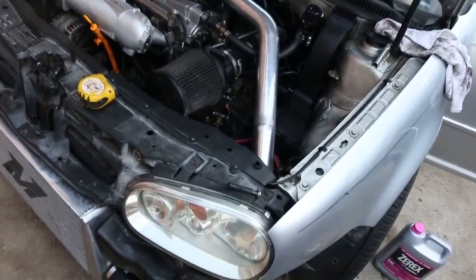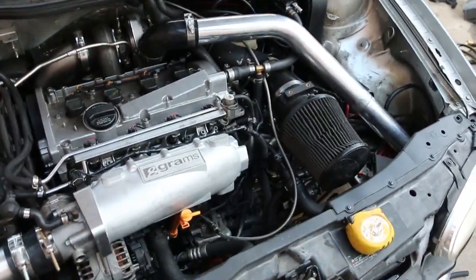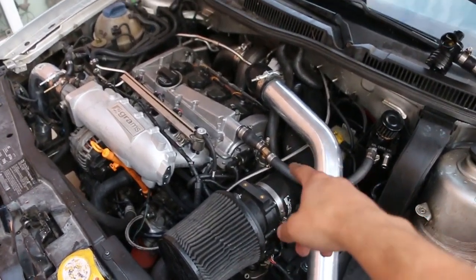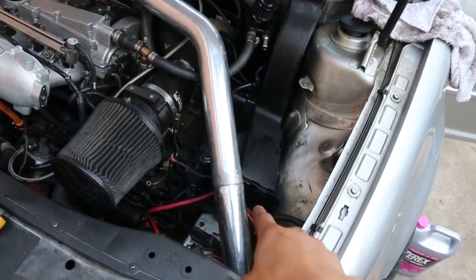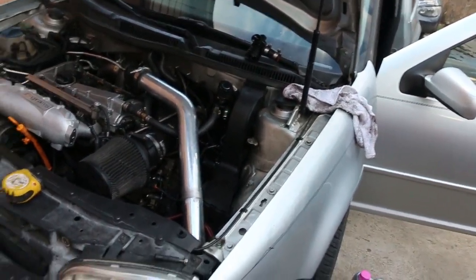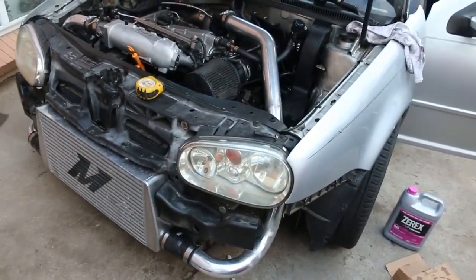We have just been steadily working on this thing. The intake pipe is all mounted up — we used the old one and a coupler we got at Blue Water Performance. We did run power so the battery is now located in the trunk. I had to weld a few holes on the aluminum intake pipe that we're not using, so that's completely welded up. We ran the power, removed the battery, and now it's just buttoning up a few small things. We just have the AFR gauge to hook up. We're going to disconnect all the coil plugs, crank it to get some oil going to the turbo, then fill it with water and do a start-up.